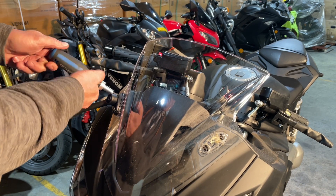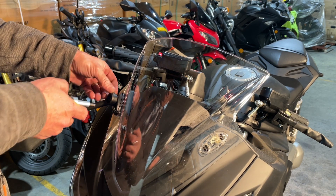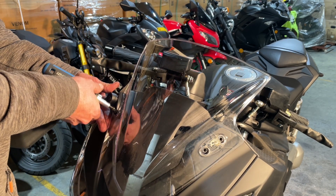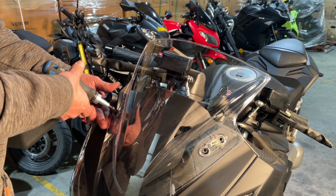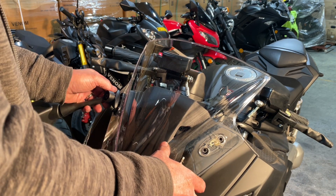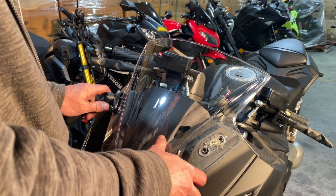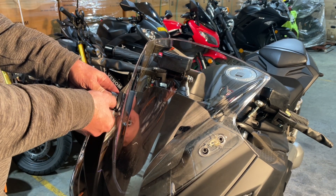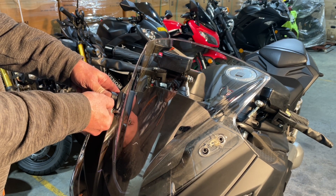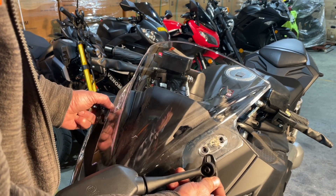You do want the center one to be fairly tight after you install the mirror because you don't want that mirror flopping around while you're driving, so I see why it was on there tight. But these ones here to put the windshield on — once you compress that rubber a tiny bit, you don't need to compress it anymore. Now once I take this off, that windshield is going to want to just fall right out, so I'll go ahead and take that bolt off and hold it. Okay, and now we can just remove it just like that.